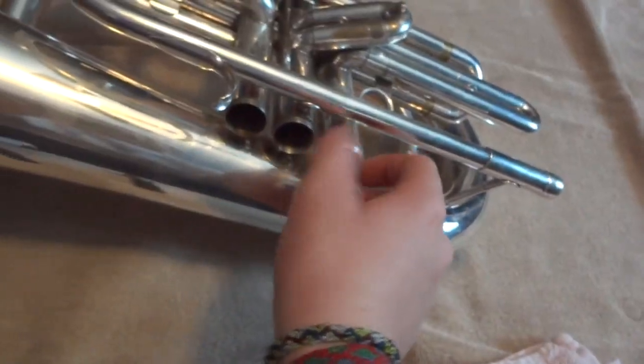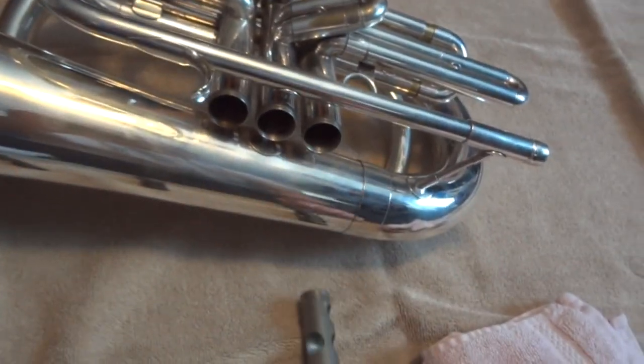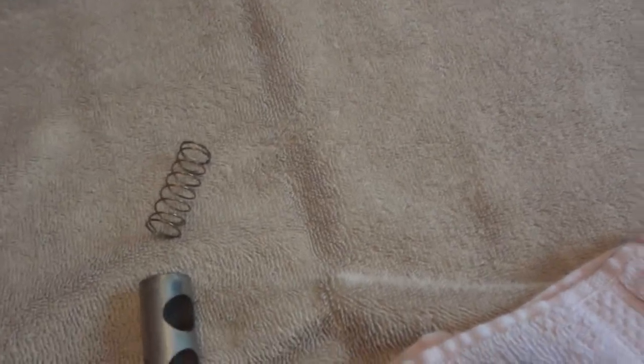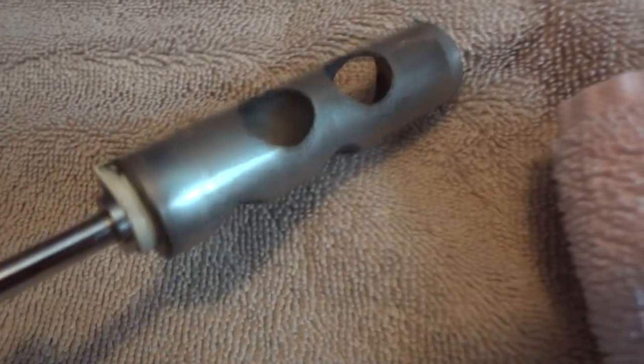That's one thing I didn't really notice because you don't look for it. Your valves should all come out now — some easier than others; mine come out very easily. Next, take the springs out. It doesn't really matter if you keep them with the valve they belong to, but it's not required. I'm not going to put this in a bath mainly because there are felts on here.